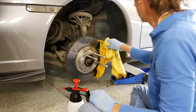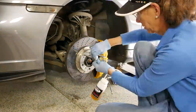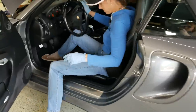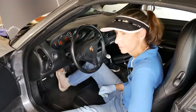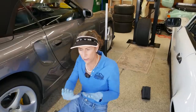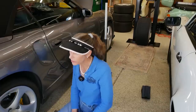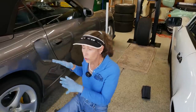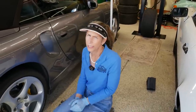The rest of the car is pretty much the same. We're going to stay the furthest away from the reservoir by doing the rear left, then the front right, and then the front left in that order. When you're completely done, refill your reservoir up to the max level, then get in and push on that brake pedal — it should be solid, hard as a rock, at least as good as it was when you tested it initially. If it feels a little mushy or soft you've probably got some air in the system and you're going to have to repeat the process. Do not drive the car unless you're super happy with that brake pedal. If you still can't get it right then you might need some outside help. Normally this process can be done in about an hour by a single person.